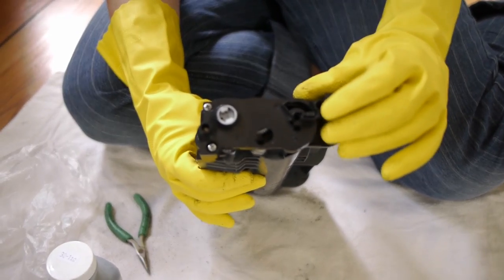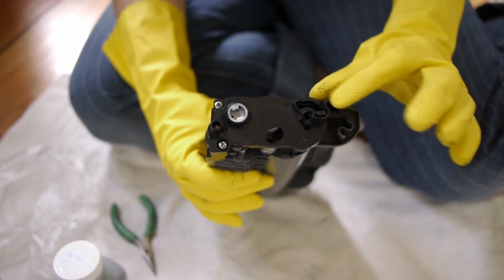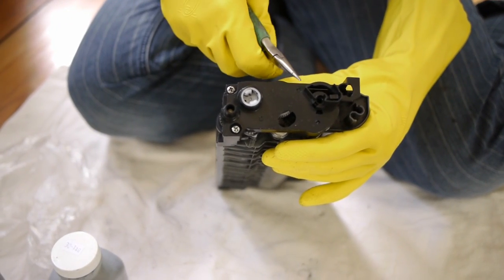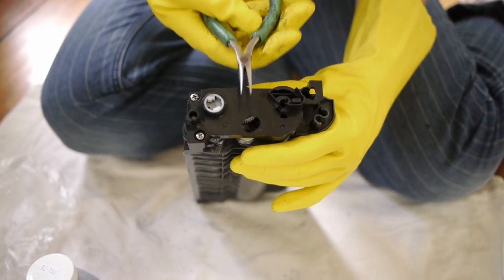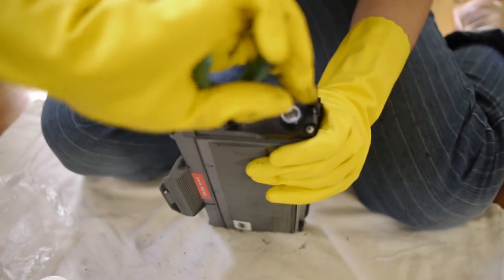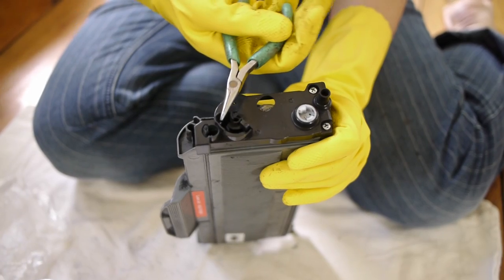On this model there's a little reset gear — it's this little black gear. What you want to do is move that back to the position it was at so that it tells your printer you've reset the toner and you don't get the red toner light. I just use a pair of pliers to do it. That's how you reset it — you can use pliers or a flathead screwdriver to reset it back.